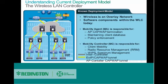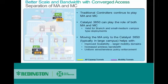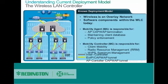But with the new 3850, the traditional controller continues to play the role of a mobility agent as well as a mobility controller, but the 3850 takes care of the role of mobility agent on it for large deployments, and it will be responsible for the mobility agent features like AP termination, maintaining the client database and policy enforcement.